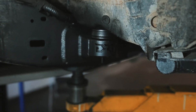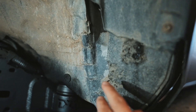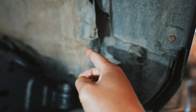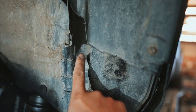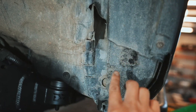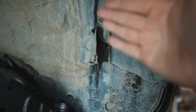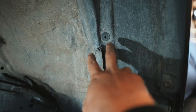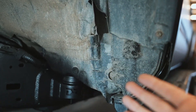As you can tell, it turned out real nice — we have all the clearance here, nothing sticking out, so there won't be any issues with rubbing at all. Another thing we noticed is that whoever did his chop before cut and smashed the pinch weld towards the inside instead of the outside. We prefer folding it toward the outside because it falls into a nice cavity and gives more clearance. We're going to peel this off, cut it, and flatten everything toward that side so it matches.